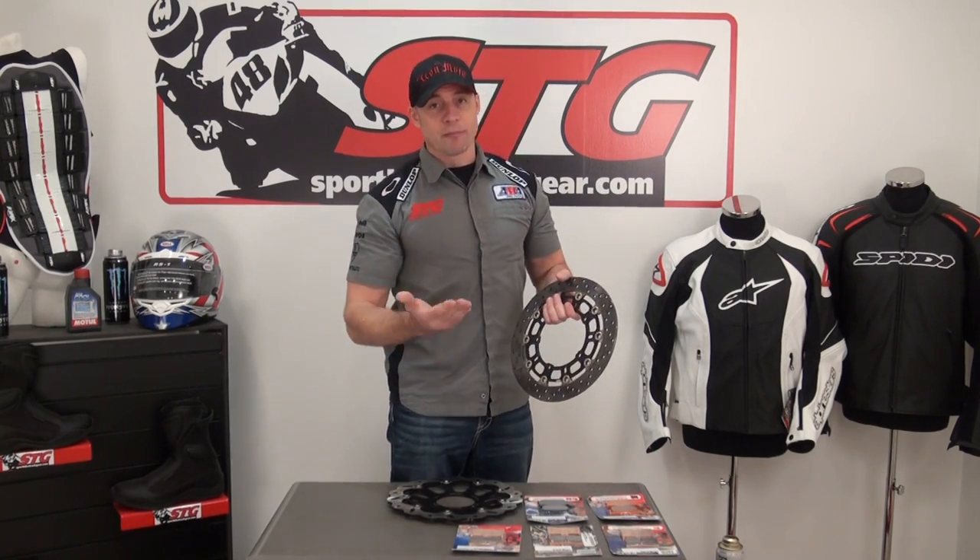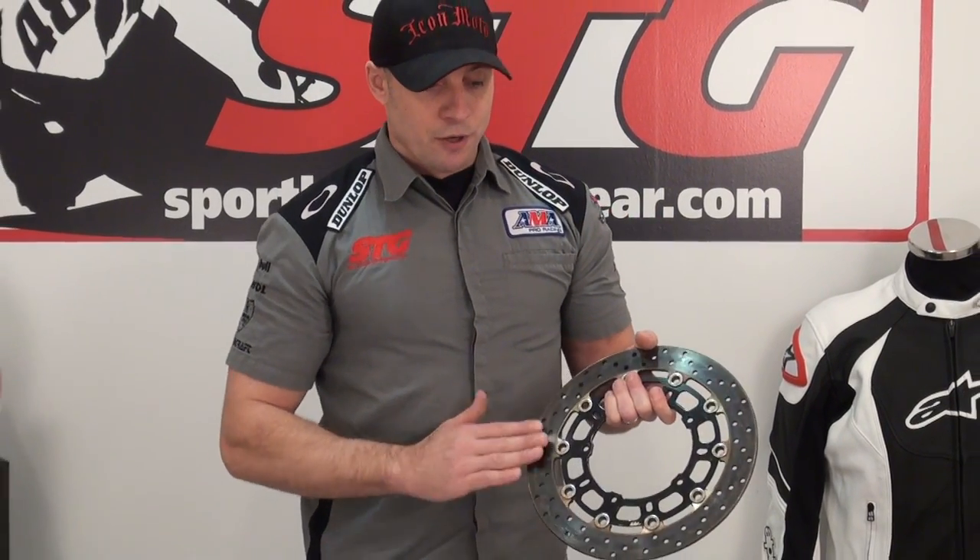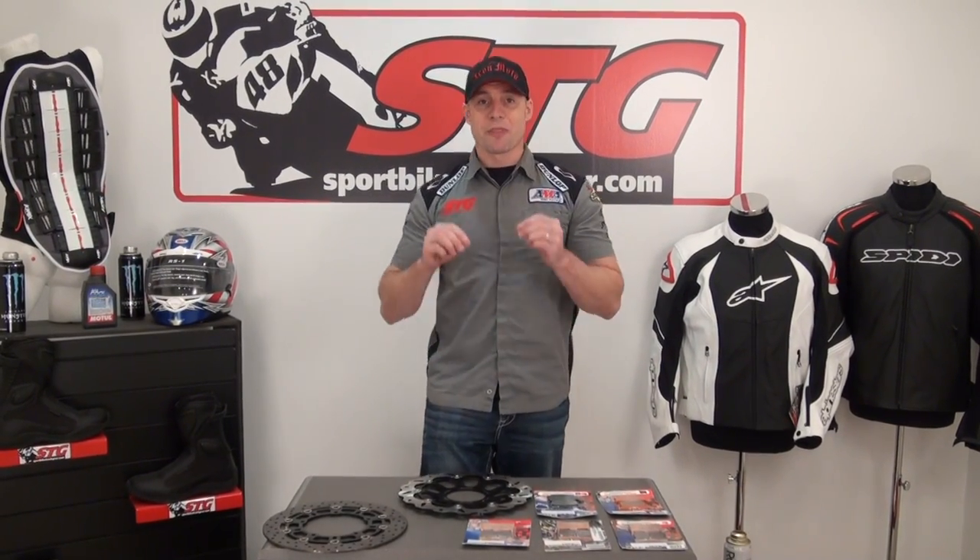Let's talk just a little bit now about rotor surface. I've done it either way — I've cleaned the rotors before I've replaced the pads, and I've just basically put the new brake pads on. Honestly, I'm hot or cold as to whether I've really noticed a difference between cleaning the rotor or just putting the new brake pads on and bedding them in without cleaning the rotor. If you were inclined to clean it, a couple of things you can do: you can get some wet and dry 400 to 600 grit sandpaper, a little mild soap and some water, a little circular motion — you're just trying to take a little of that embedded friction material off, not trying to take metal off. Or you could use something like a steel wool pad, just lightly try and clean a little bit of that off, maybe get some brake cleaner, spray the rotor off, get the debris off, then go out and go through your break-in procedure. Some recommend that you do it, but the most important thing is the bed-in procedure.